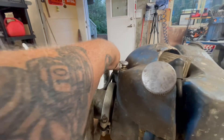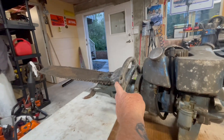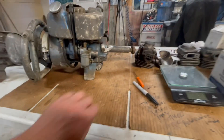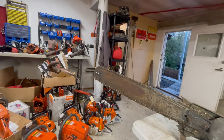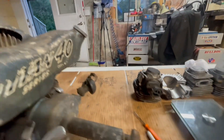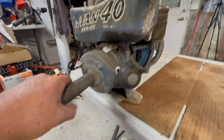When Tillotson came out with the diaphragm carburetor — and Tillotson was the first innovator of the diaphragm carburetor — that changed things. With this float carb saw, you turn the blade here so you can fall with it instead of buck with it, then you turn it back and lock it in position so you can buck with it. Pretty unique — this thing is really cool and it's actually in pretty good shape. It still turns over and has the old round-tooth half-inch pitch chain on it, which is really neat.